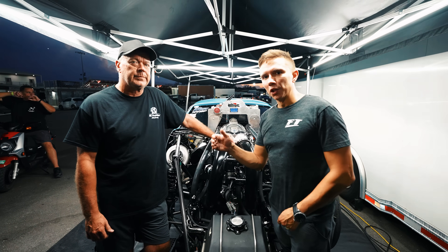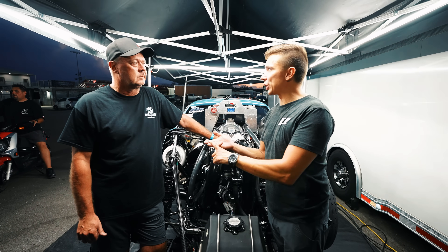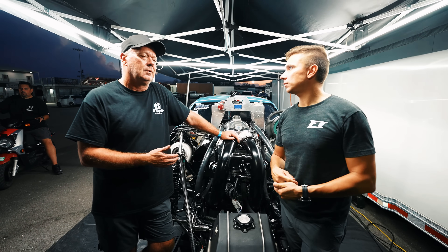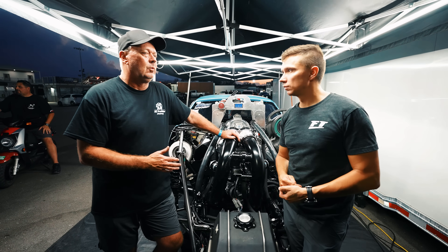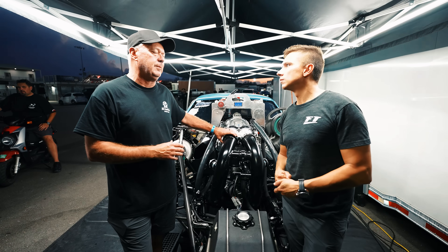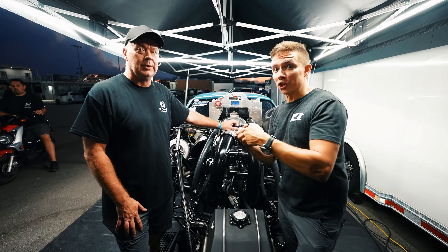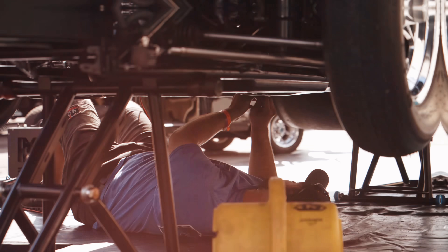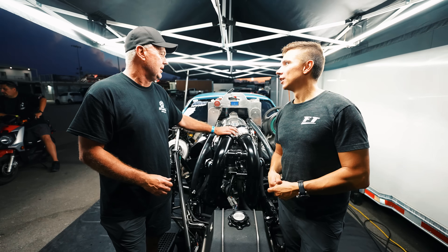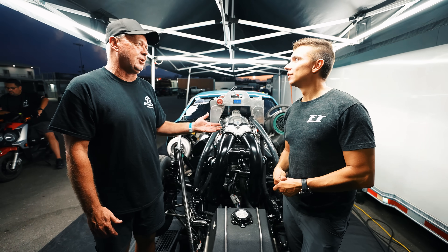I try to tell people: we manipulate the tune-ups on power management, but probably 75% of what we do is race car — it's chassis. We crawl under there and move stuff — weight, struts, shocks, ride heights. Everything. This car is eighth-of-an-inch sensitive for me. If I bring the crank up an eighth of an inch, it's a whole different race car. It's massive. It's just the package. We got a good package. It's the E-gate — lets us get away with stuff we could never get away with before, lets us do stuff with a converter we could never dream of doing before.